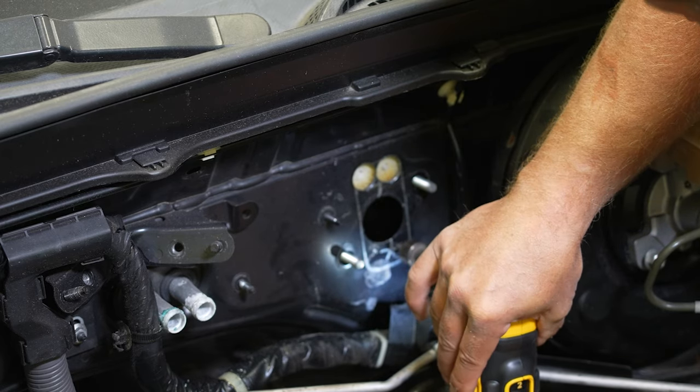Again, these fittings, if you're running, say this kit's on a TR6060, these fittings will be a little bit different, so just keep that in mind. But it all has to do with the slave cylinder you're attaching it to. Just like if you bought the CD009 kit, this is real simple. You're just gonna hook to the external slave and it's a single banjo, but these T56 slave cylinders are a little different. So make sure you got your washer in there. We're gonna thread this fitting on and you just snug that guy up once you get it on there. All right, we got a finger tight. Throw a wrench on it here real quick and just get it snug. Quarter turn, all to do it.